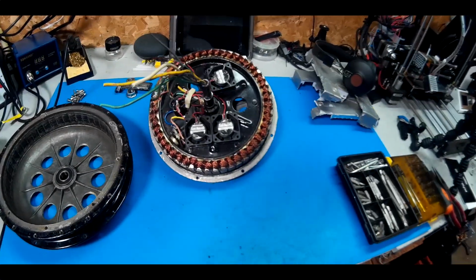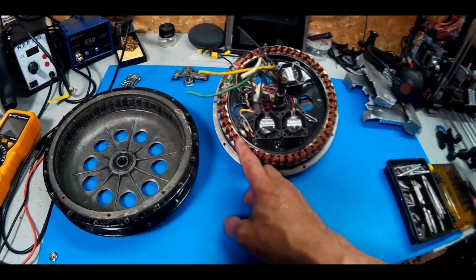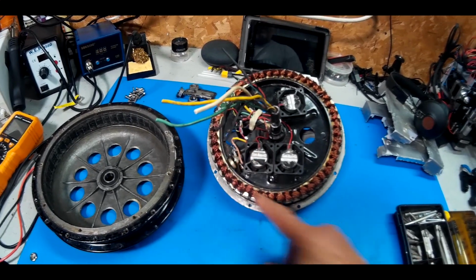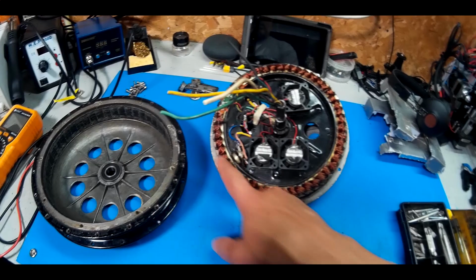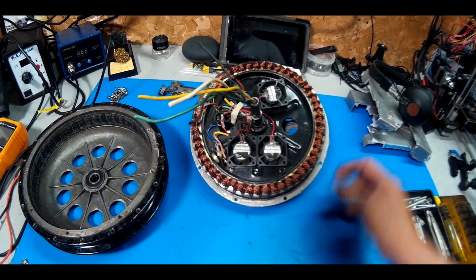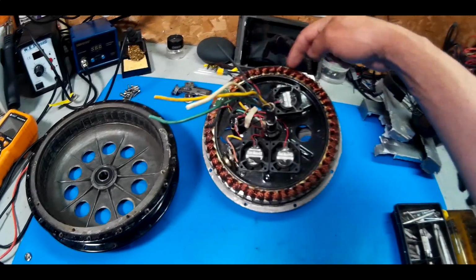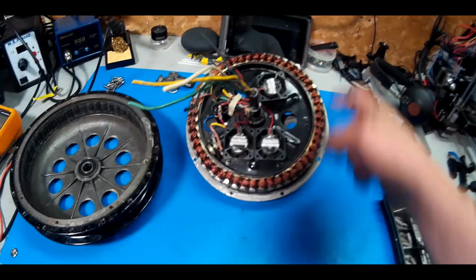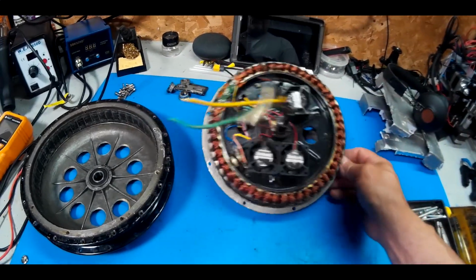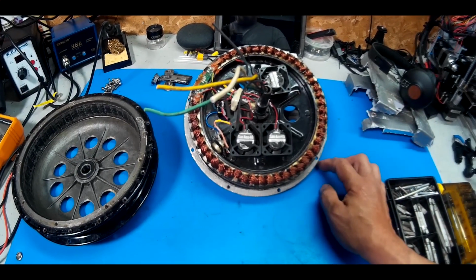The windings are darker. I thought there was going to be some bad burns in here because you could literally smell this when it was done a ride. But it's evenly baked all the way around. This used to be orange, now it's like cherry red. The only time you really have to worry is when it gets black around the joints, or if you have a full phase that's going black but the rest stay light, then you know your motor's on the way out. This one here is just basically broken in. There's probably lots of life left in it.